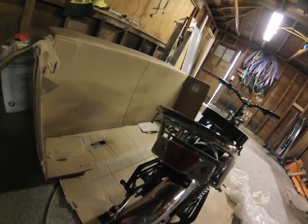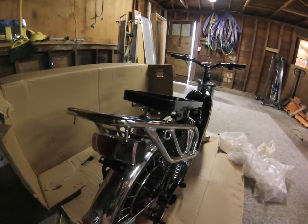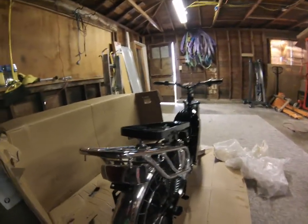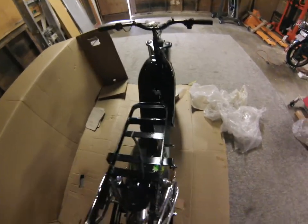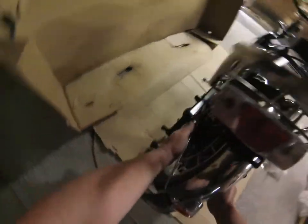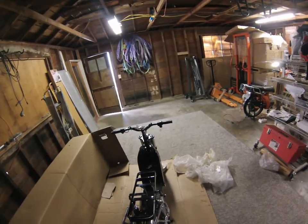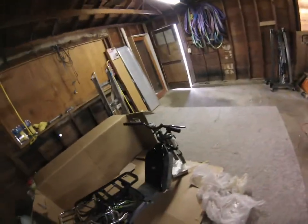The rear nuts on the stand are shipped loose — there's a little keeper fastener on there but you can't tighten it too tight, otherwise the stand doesn't want to pull up with the spring. You may want to replace that with Loctite Blue so it doesn't spin off, or put a nylon locking nut on there — just an 8mm by 1.25 pitch nut from any hardware store. The shocks have a habit of rubbing against the plastic; it's best to put a washer on the back side — an extra spacer washer is included with the fastener kit — one below on each shock on each side on the inner. Carefully put those nuts back on as they strip easily if over-torqued. Just compress the rubber a little bit, maybe 20–30 foot-pounds. Loctite Blue is your friend.